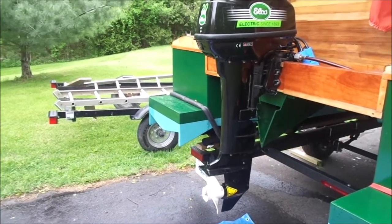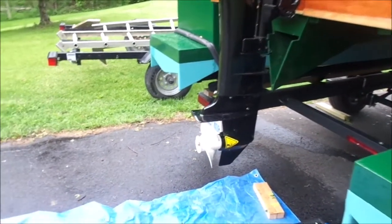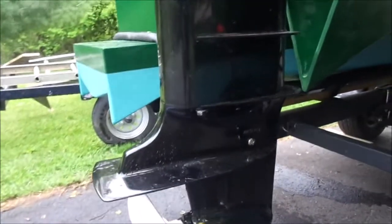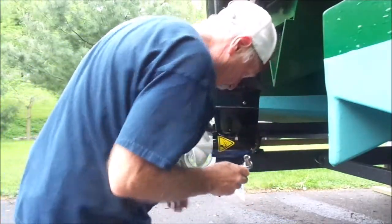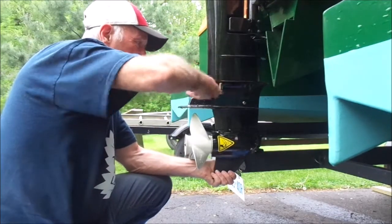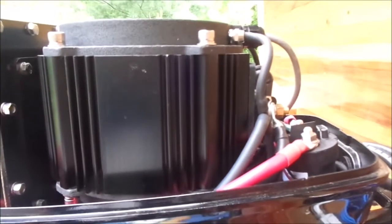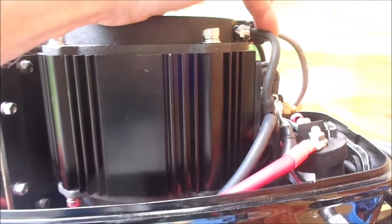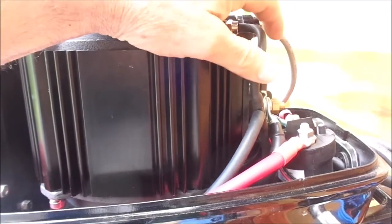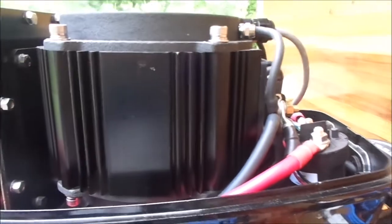They were good enough to walk me through some tests, and I'm going to now take the bottom section off — the bottom housing — held with just four bolts. One of the first things I had to do for checking for any blockages was to disconnect this hose, blow through it, and I should be able to blow through it freely, which would check for blockages.